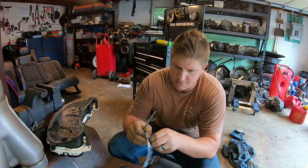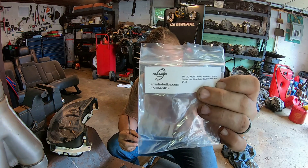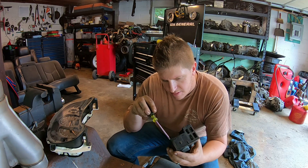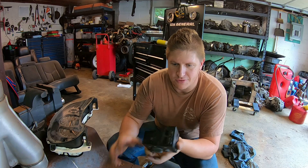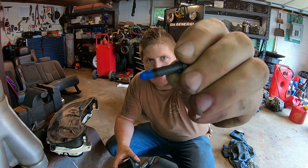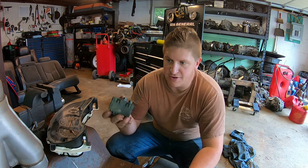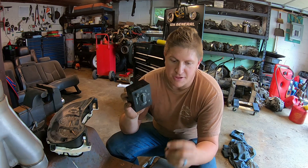This one is definitely bad. So here's my new one. I ordered this from caraudiobulbs.com, which the prices seemed reasonable and he got it to me quickly. Put the new one back in there, twist into place. The old one here — you can see how it's blackened and burnt just below that blue part. That's a really good indicator that the bulb itself is burnt out, on top of the fact that I had this in a truck and I know that it didn't work. The light switch, the dimmer switch — all of that does what it's supposed to do. I just needed a new bulb.